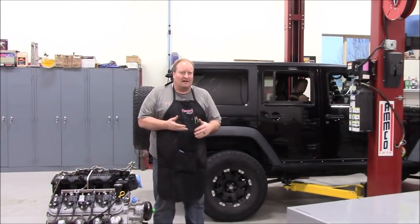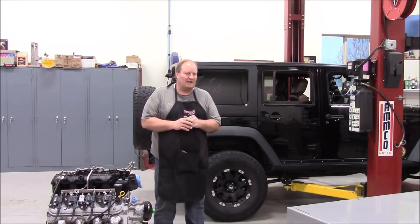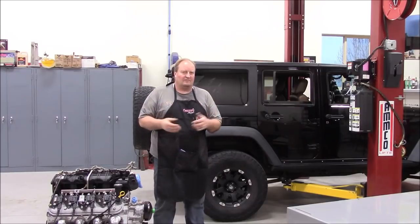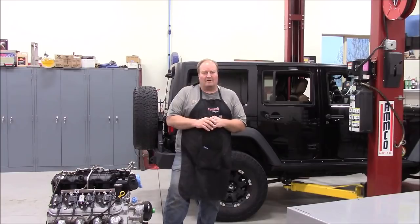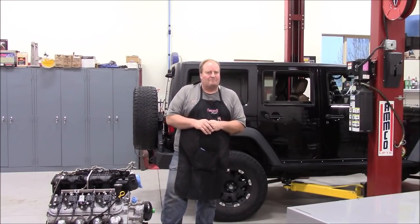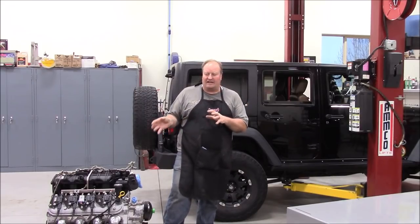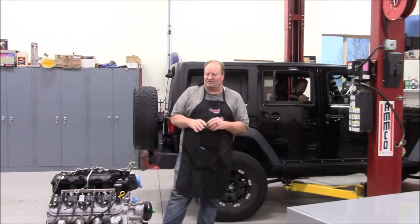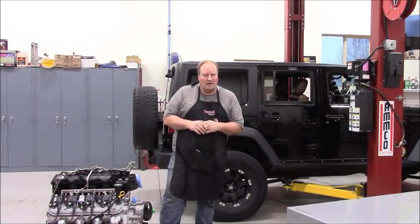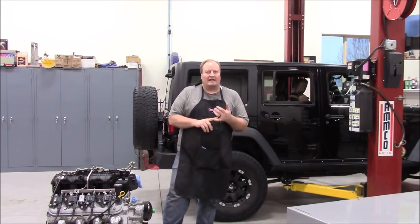This is stage one — it's probably not going to be a step-by-step guide. If you're familiar with engine swaps, this isn't anything you can't do. The biggest issue with this one is going to be the electrical and electronics — the CAN bus system from the Jeep tying into the network on the GM side. That handshake between the Jeep CAN bus and the GM ECM/TCM is probably the biggest hurdle of the whole engine swap.